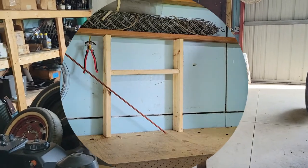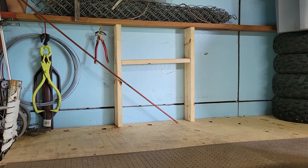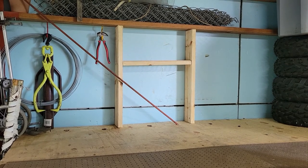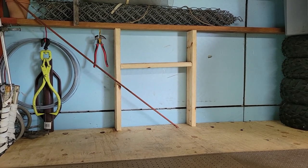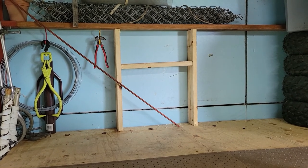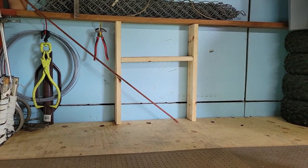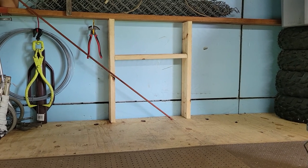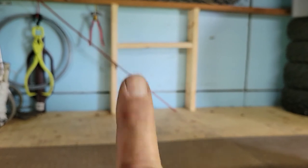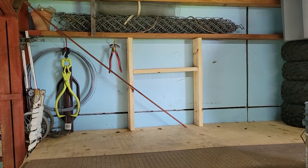I took my ladder away — and there is the finished product. Now I know this centerpiece isn't straight, and that was a struggle just trying to get those holes through the siding in the little bit of room I had. We lagged three bolts — like screws — into that crossmember and cinched it up tight. Then I cut two verticals and put one on each side, screwing those into the horizontal as well as the top. I pinned them on the bottom too. So we fixed the wiggly carport.